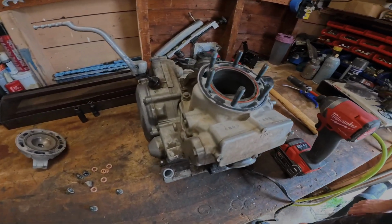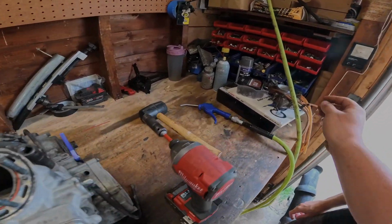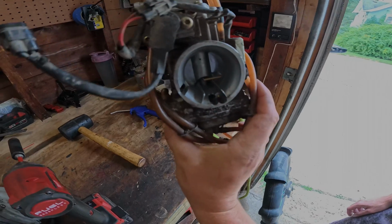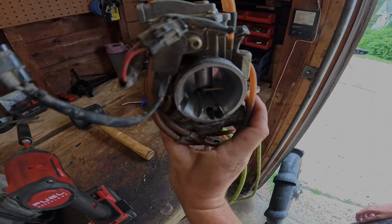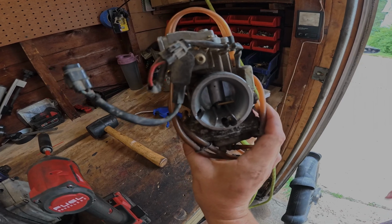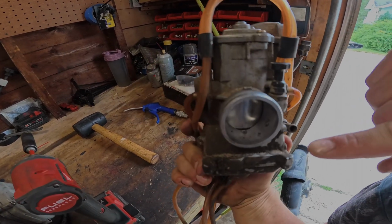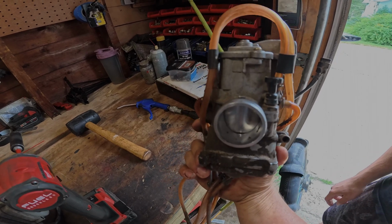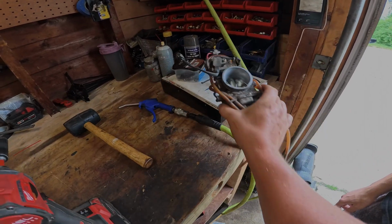More than likely, the main failure was just the sand consumption through the air filter and through the carburetor. You can see there's a little bit of sand built up on those bottom air ports. You can see it on the other side. Yeah, there's sand in some, they're wet too, literally with the gas. Not good. Not good at all. No bueno.